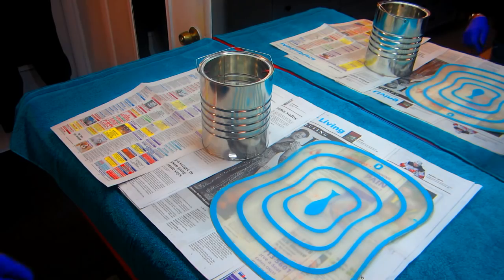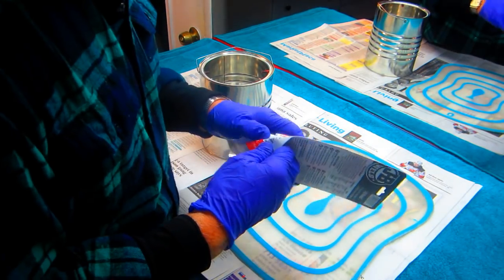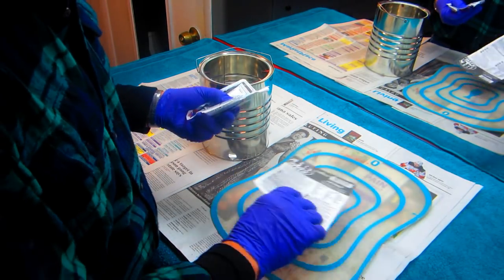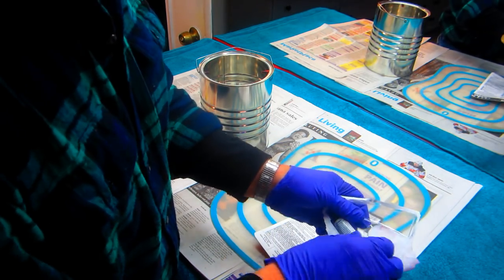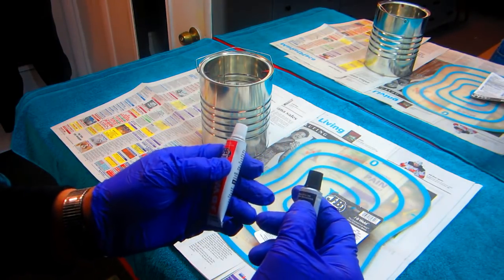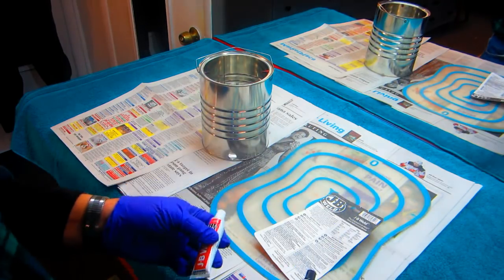Now, I thought this would be the most important step of the whole process. A lot of these things may be oversimplified, but I want to say them anyway. This is a Teflon mixing spatula for Bondo. You can use the back of that, of course. The trick with this, it's not ultra critical. When you have epoxy where the ratio is 93:7, yeah, it's critical. But these epoxies, whenever it's 1:1, they're not critical at all.